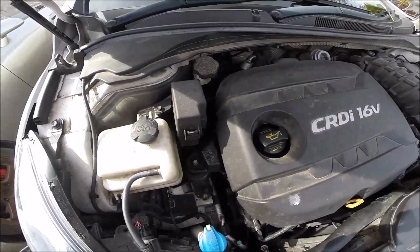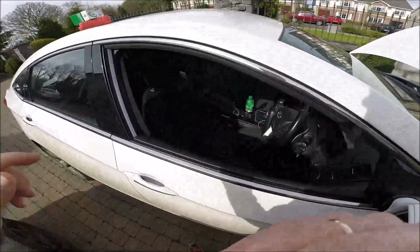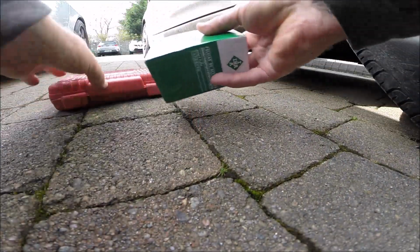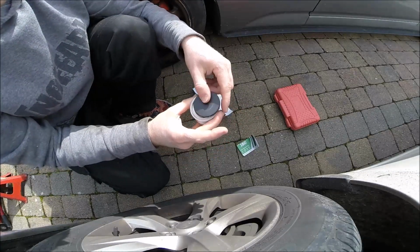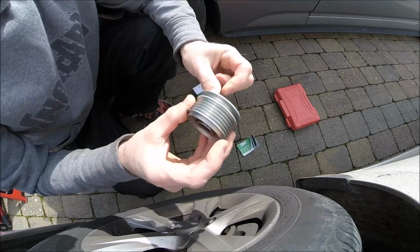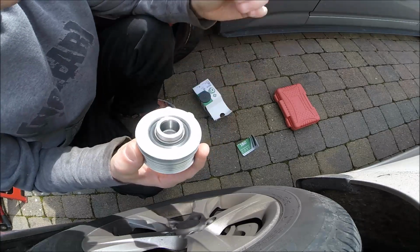So all right, the alternator is actually there, so we have to remove it, with a few tools for this, and hopefully we can do this exactly here. And the alternator pulley looks like that. I'll quickly show you what's in the alternator pulley. That's the special cap here, that's the pulley. Inside we have the clutch, so the alternator moves only one way, impossible to move by hand. But very often it makes a ticking noise like that, because the bearing inside is very sensitive.